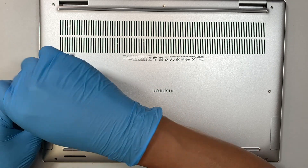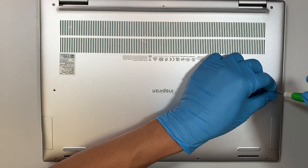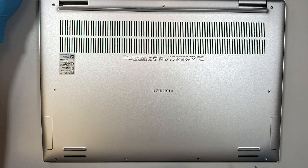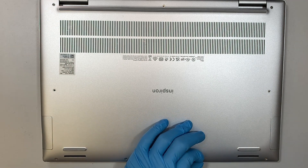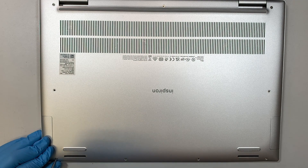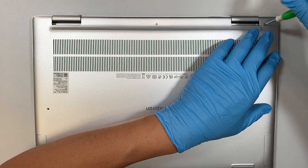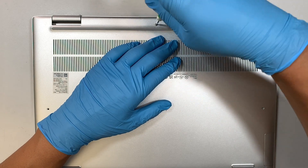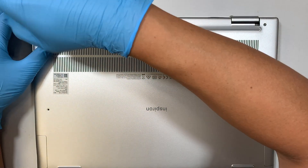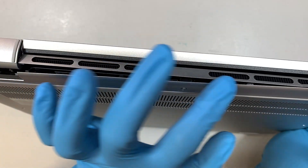Let's go ahead and remove the screws. There are four screws at the bottom. Once you have removed those, work on the ones on the top. The top screws do not come off — when you unscrew and you hear that little clicking noise, that is when you need to stop, because the screw has reached its limit and is separating the plastic cover.